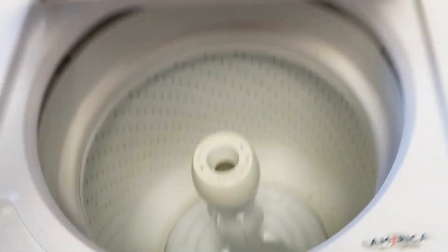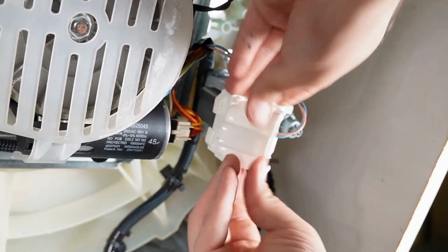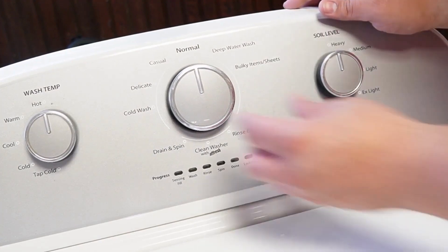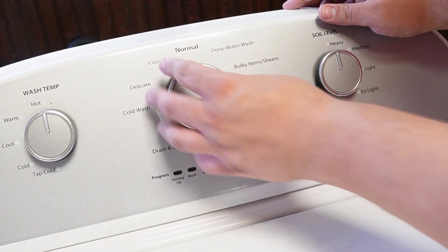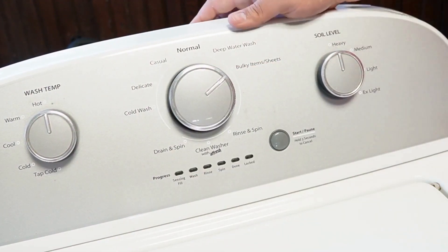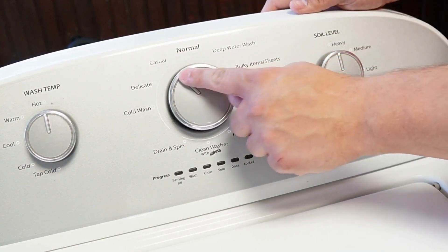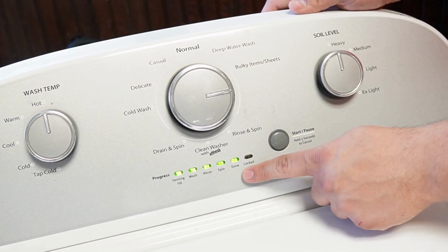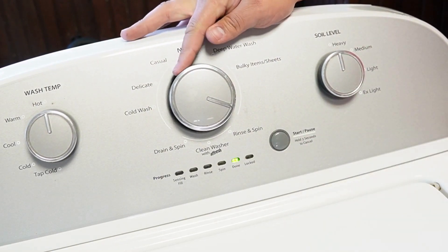Now that we've done the first reset, let's attempt to recalibrate this washing machine through the calibration mode. This is a must-do if you've installed any new parts on the washing machine, from a board to a balancing rod. With the washing machine freshly rebooted, rotate the dial counterclockwise 360 degrees. Then turn the knob right three clicks, left once, then right once again. You need to do all these things within three seconds, and it may take a few attempts. If done right, all the lights at the bottom of the washing machine control should flash on and off, showing that you've entered diagnostic mode.